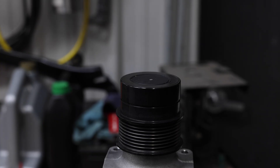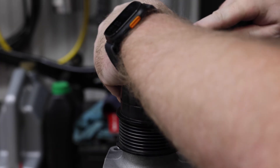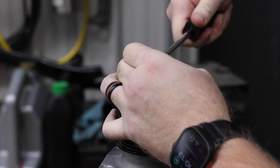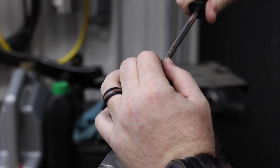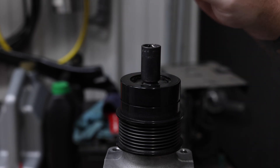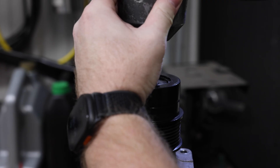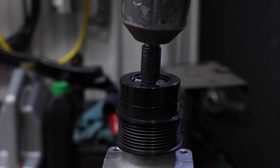Once you've got the cartridge out, it's time to swap out that pulley. You'll notice there's a plastic cap here — take a good pick, pop it in there, and kind of find a bit of slack to turn, twist, and pry that cap out. There is a hex head in there, so just be careful. When using your vice and removal tool, once you have the plastic cap out, take a 17mm hex, drop it at the end of the factory pulley, and use an impact or brute strength to pop that factory pulley off.